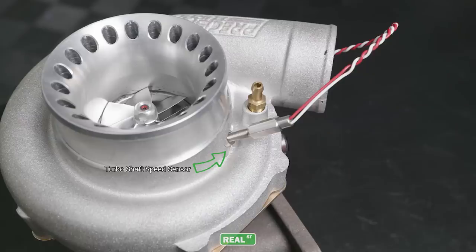If you're looking to optimize the AR of a particular turbocharger, a shaft speed sensor and exhaust back pressure sensor play a critical role. In a perfect world you'd have a higher inlet pressure than exhaust pressure while maintaining reasonable transient response, because you don't want the turbocharger to be overly lazy. Each turbocharger has its own character — the larger the turbocharger, the lazier it's going to be.